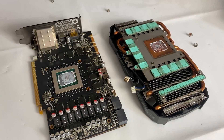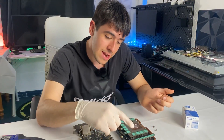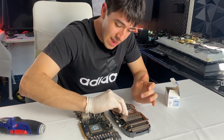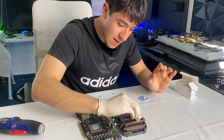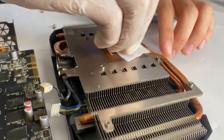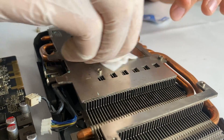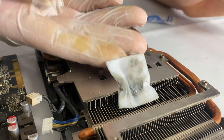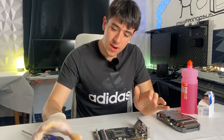Take note of the thickness of the thermal pads — in this case it's 1mm all around and 0.5mm on the VRMs. Now with no thermal pads remaining, you really want to use isopropyl alcohol and go all over the entire card, because there will be some dust remaining and it's going to be dirty. This won't fix the card by itself, but it's a good measure to bring it back to looking brand new. As you can see, this card definitely needs it.